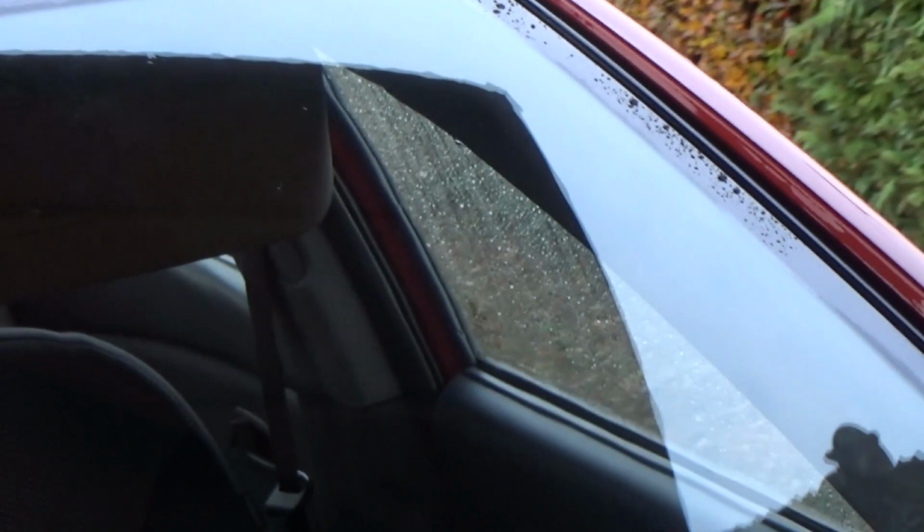I've left roughly an inch going around the glass there just to make sure that I didn't accidentally stain or mark the plastic trim there. So that is now ready for applying a glass protection or sealant product. And the reason we want to do that is obviously, like any protection product on your car, the cleaner the surface is, the better the protection product has at bonding with the surface, and therefore if it bonds better, it will last longer. So that's why we've done this. In the next video I will be applying 2 separate types of glass sealant to the glass there, one on each side, and that will be to help sheet off the water, sheet off rain, and make driving the car a little bit safer and easier.